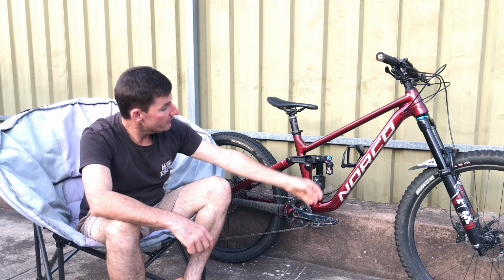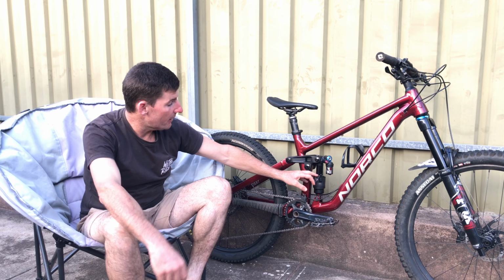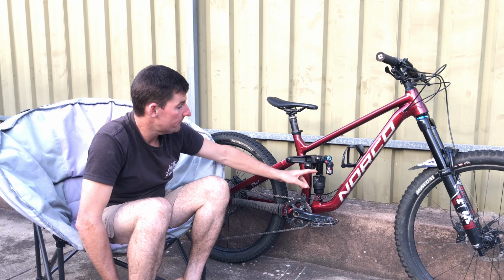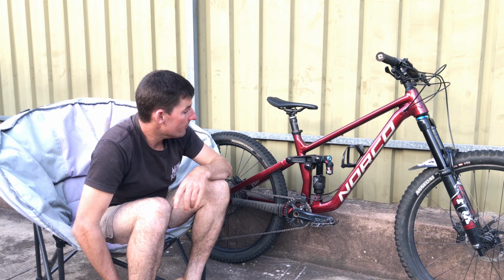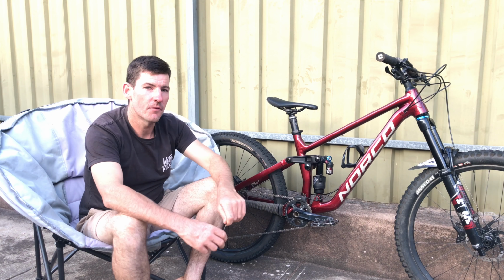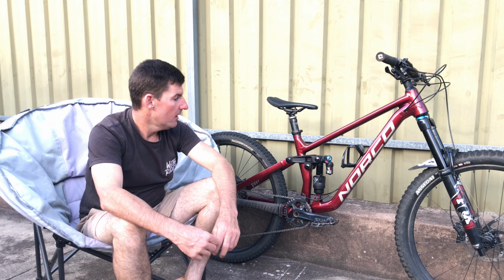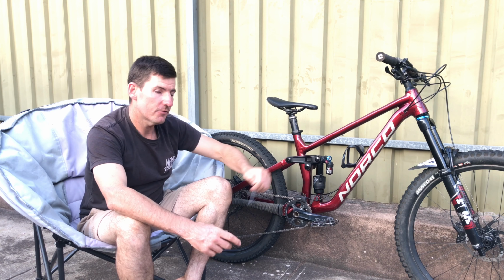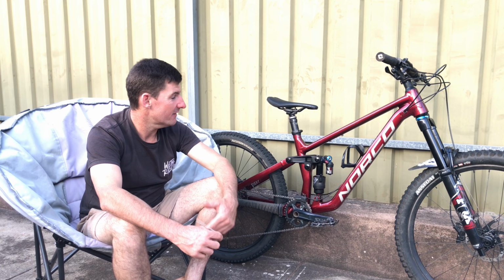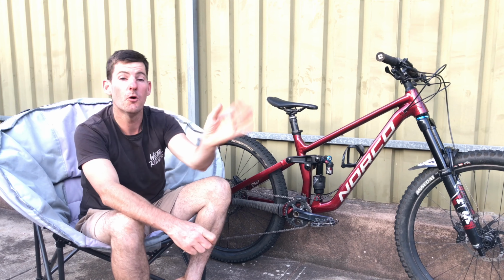And the reason I've got 4 clicks, that's relative to the spring rate, because I'm running a deeper sag, 19 mil sag on a 52.5 mil stroke. We're quite deep in the sag, so I'm leaning more on compression for my control and my resistance. Low speed compression is only 3 clicks in from open. Go 4, 5, 6 clicks in and it starts to get real stout out the back. Surely you get more to push against and it feels more poppy and playful.